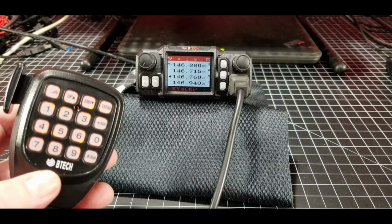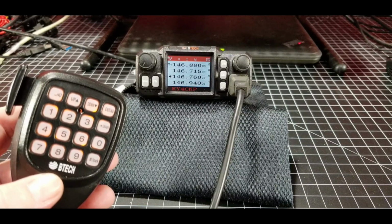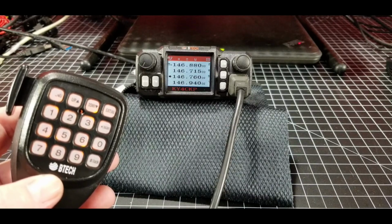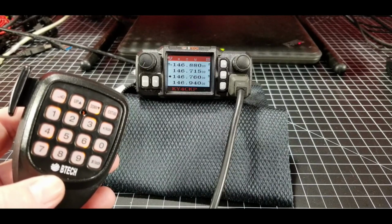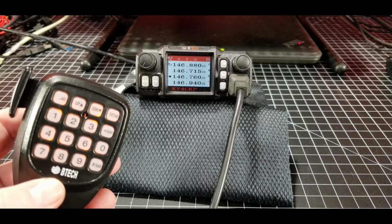Usually the 25 watt and less units can connect to a 12 volt accessory adapter, again, what we might have called a cigarette lighter adapter in the past. Usually once you get up to more like a 50 watt unit and above, those will need a direct connection to the battery. Now you can take units like this one directly to your battery, but they come with a cable that you can take to a 12 volt supply, and that's usually what I just do.